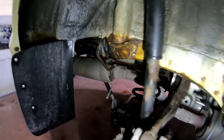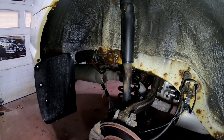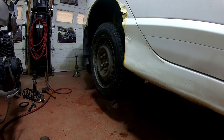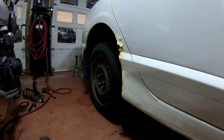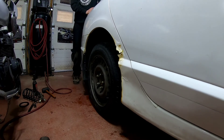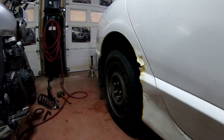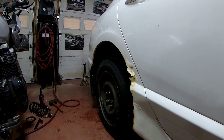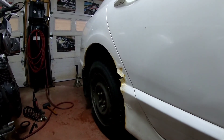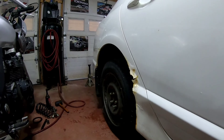Now I'm going to put the wheel back on, lower the car down, and see where it sits on this side compared to the other. Then I will move on to the other side. So this side, I got it down off the jack — at about 5/8 of an inch, a little higher on this side than the other. Obviously I've got to drive it around to get it to level out once I'm all done, and then probably bring it in and adjust it up or down. Well, I can't go down actually because the spacer's all the way down, but go up if I can. And if it is higher in the back than the front, it's not a big deal.